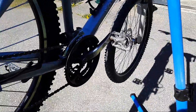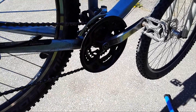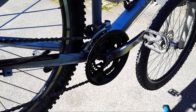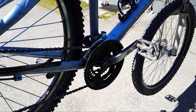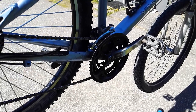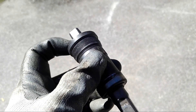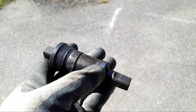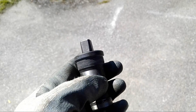The next thing is to install the pedal assist sensor in the bottom bracket area. I'm not sure how it's going to work, but we'll find out. I'm going to turn the bike around in the stand and start removing the drive side crank. I ended up removing the complete bottom bracket because you simply have to do that to get access to either end. This was the drive side end, and I first thought I would install the PAS sensor there.